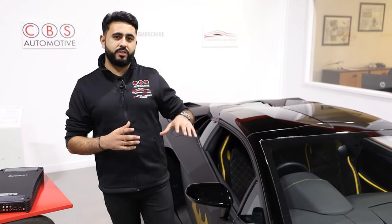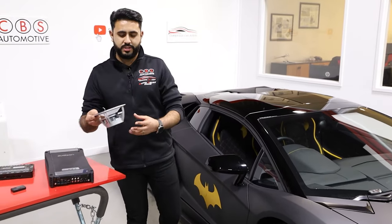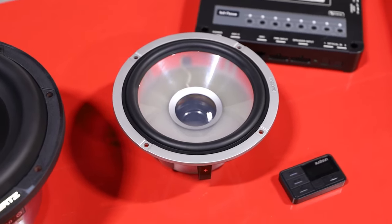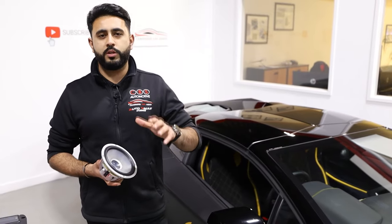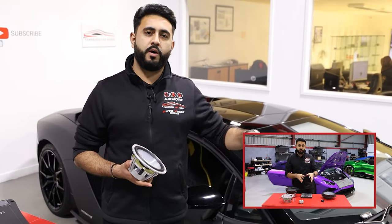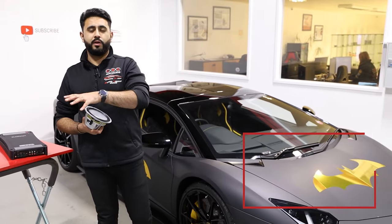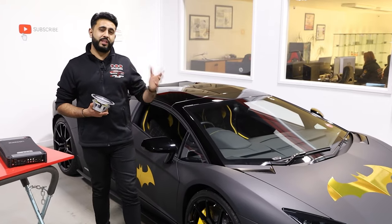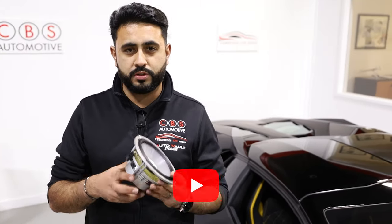Inside the door, we're going to be soundproofing completely using a Skins 2mm liner. Then we're adding in the Audison Thesis sax — a lightweight, neodymium magnet six-and-a-half inch driver — an incredible bit of kit that's going to be sitting in a stock location behind the speaker grill. Coming up shortly on our channel will be a 'sound off' video — a new episode in the Behind the Sound series — where we compare the factory tweeter, factory door speaker, and amplifier against what we're putting in, weighing all the products and going through the positives and negatives of factory equipment versus our upgrades.